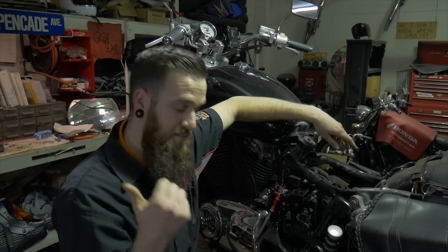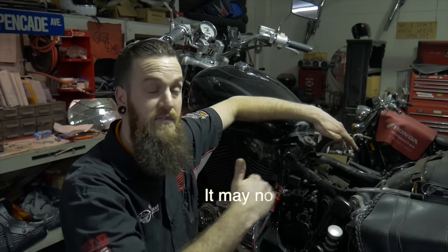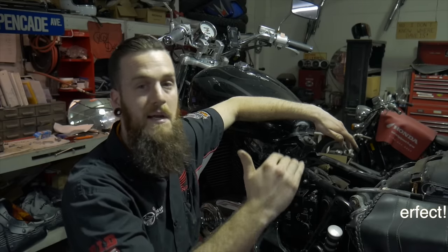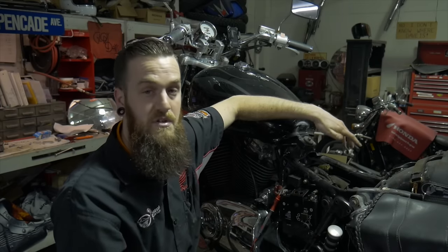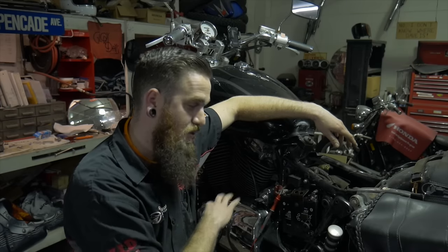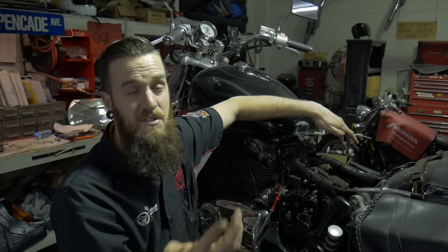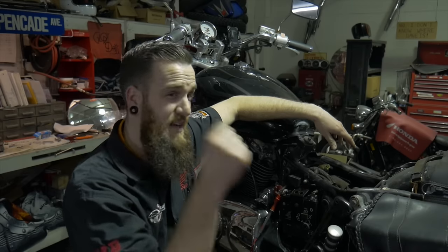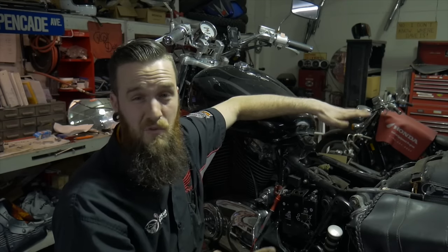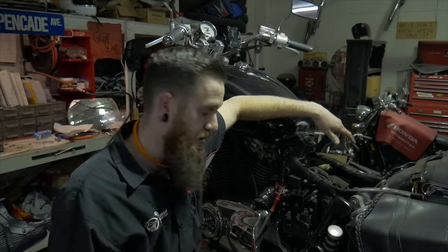It's actually very rare for regulator rectifiers to go bad on Hondas — usually it's the stator or the harness connections. We'll swap it out and double-check it. The threshold should hit 15.5 volts and either hold there or start dropping to 14.7, climb back up, and cycle — that means it's working exactly as it should. The same test works on any bike: it tells you if it's charging, if it's overcharging, or if it's undercharging. If you're at 5000 RPM and only seeing 13 or 14 volts, it could be a battery problem or insufficient stator output.